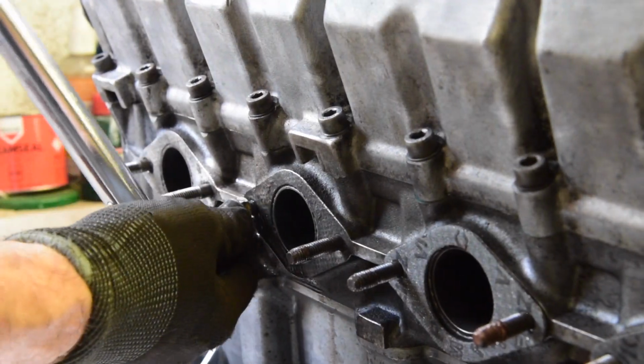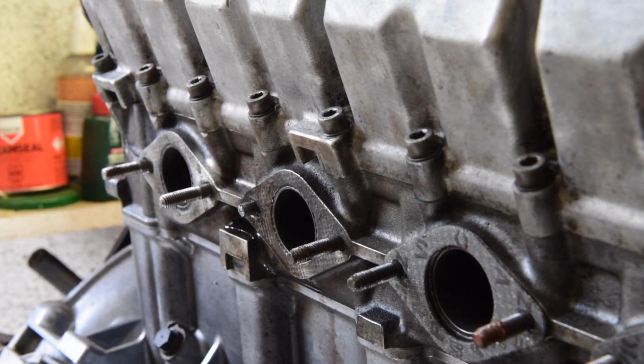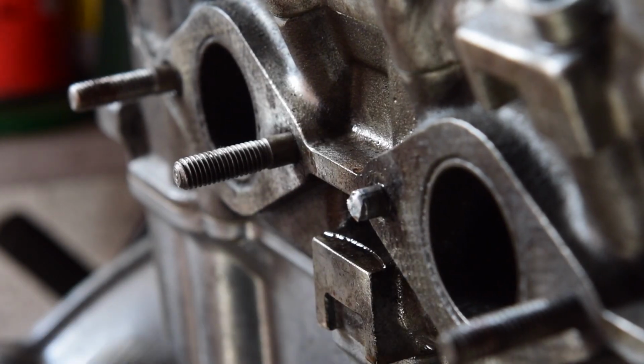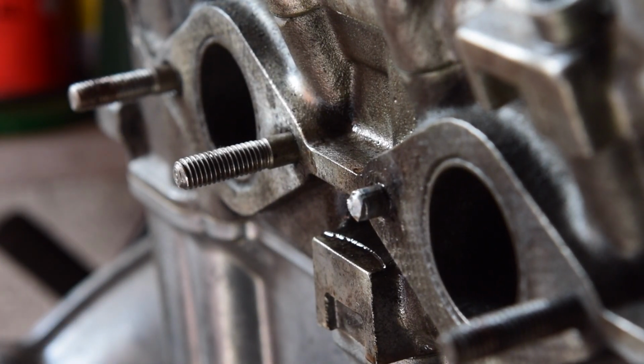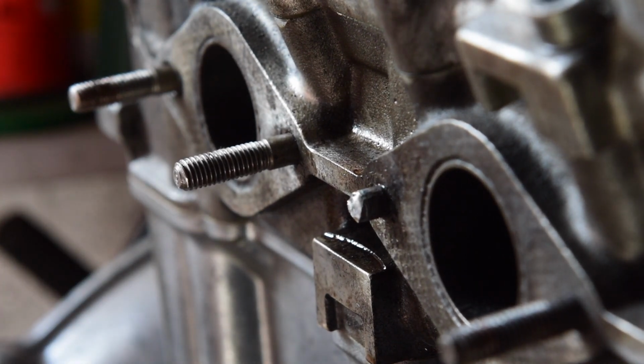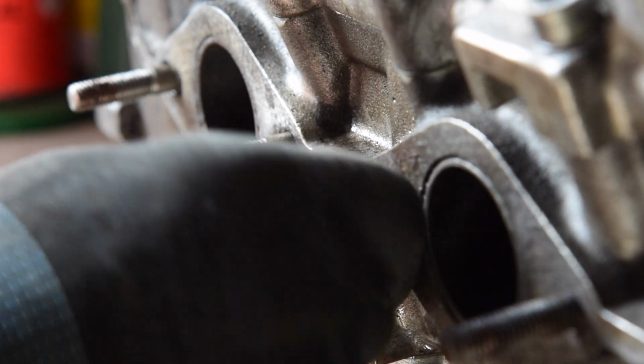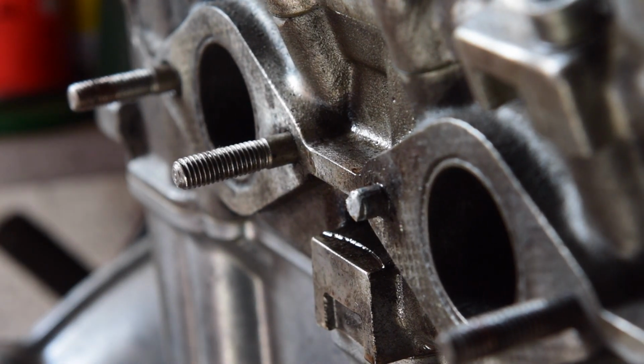It's just snapped off again, taking the nut off again. So we're not getting a strong weld for some reason. There's quite a bit of weld on there. I don't know why it's just not holding on. I could try putting the nut on deeper and trying to get inside and welding inside it. Perhaps try that.